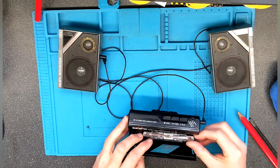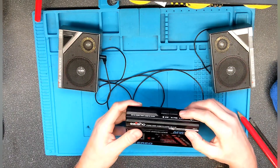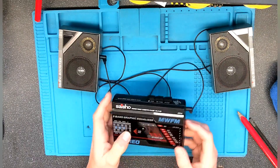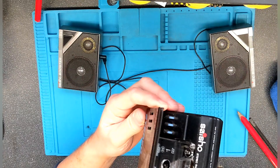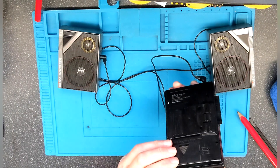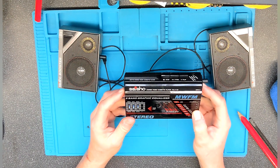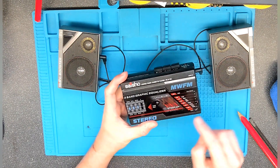It's a difficult mechanism to get on top of. The contact cleaner worked absolutely spot on. I think it just needs a tidy up and a clean, because everything else seems to be working absolutely spot on. You can see inside it's a little bit grimy — the head probably needs a clean. The belts seem absolutely fine, there's no slipping at all and it sounds like it's running at the right speed. We'll give the whole case a clean with some alcohol, and maybe get some of these scratches off the front with some Brasso.